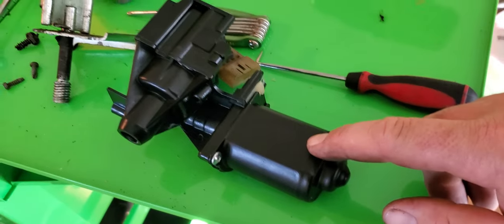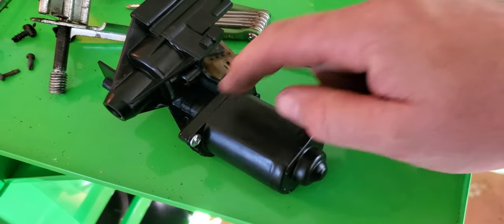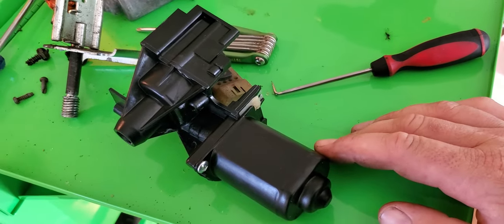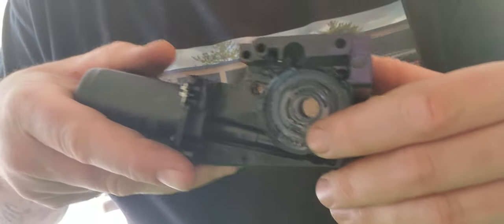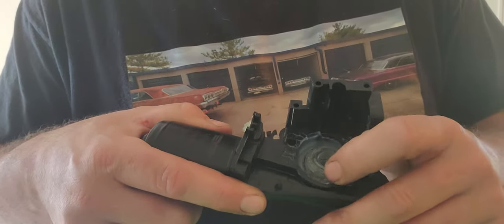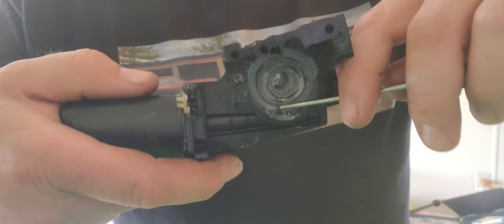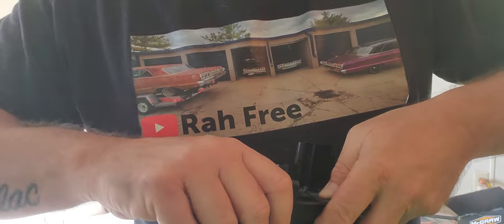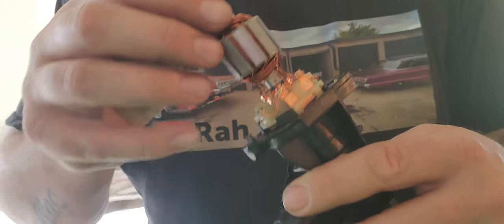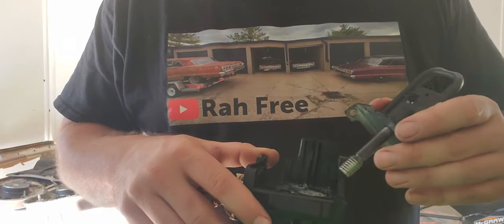I know I said these things were a pain to take apart — it's been quite a few years since I've done one, and I did it in the car and it was a nightmare. But it's actually pretty easy once you figure it out. I'm going to go ahead and take this one apart since I'm doing it on the bench. I've got my little pry bar tool here — I'm going to use it to pull them brushes back so it can go back together easier. I think it'll be faster than digging out my power probe. You may be able to stick a small screwdriver down there, kind of hold that spline, and be able to pull this cover off. This cover has magnets in it — that's what makes everything come off when you take it all apart. But if you can hold that armature in there, it'll save you a headache of having to deal with them brushes. I just stuck my little pick down in there on the opposite side of the gears because that was the only thing that really had room. It's just a little bit of black paint on there — didn't really do a whole lot of prep work, just kind of wanted it not to shine.